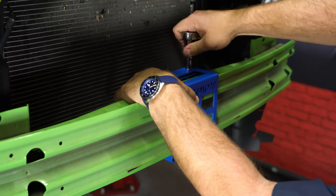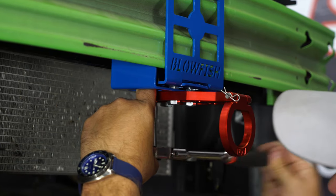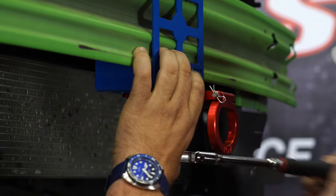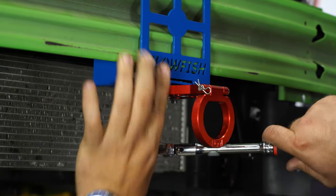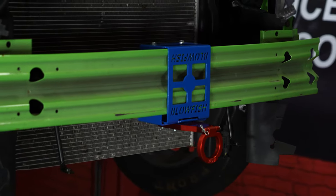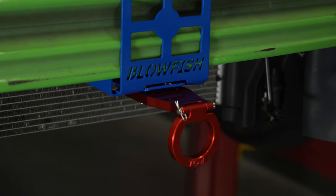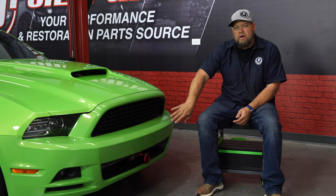Now we go back and tighten the hardware. With everything tight, we're done with the installation of the tow hook — reinstall your bumper and your installation is finished. One thing to mention is that our car does have a Roush High Flow lower grille, so it's wide open making for an easy installation. Now if you do have the factory lower mesh grille, you will have to trim the grille. If you do have certain GTs or a Boss Mustang, there is minor trimming required inside as well. The instructions detail exactly where to trim and even provide a template.